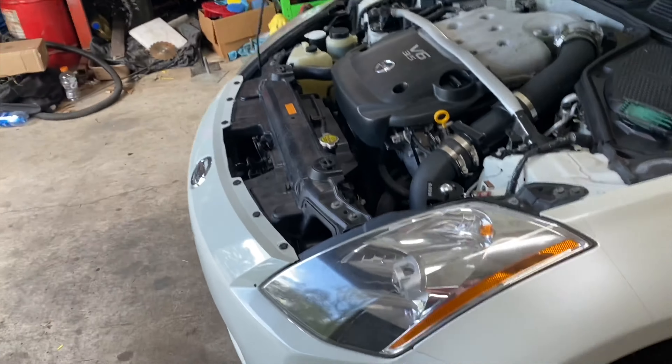So I got the cover off. This is the PCV valve, and it goes right into the bottom of the intake. What I'm going to do is take this hose off, run one hose out around to the catch can, and then the same to the PCV valve. This one's going to go into this side, and then it's going to come out of this side and into the intake. We're probably going to snake this under, and then this is going to run down into the catch can, and then the other side is going to come out into the PCV valve.